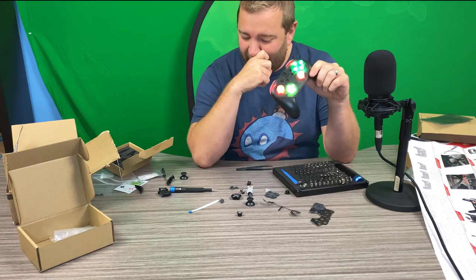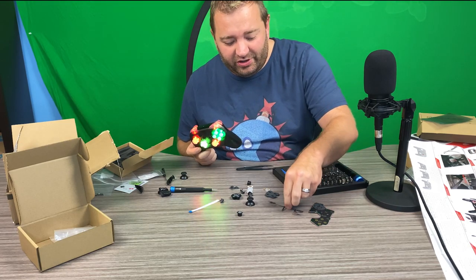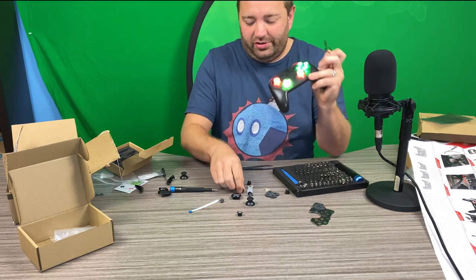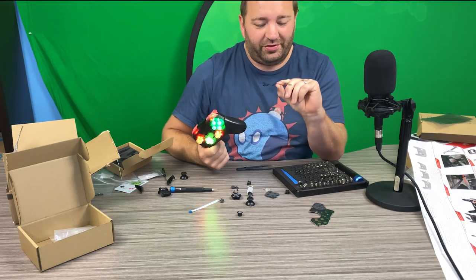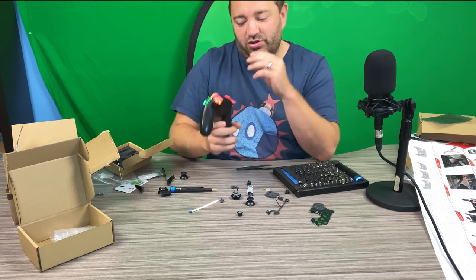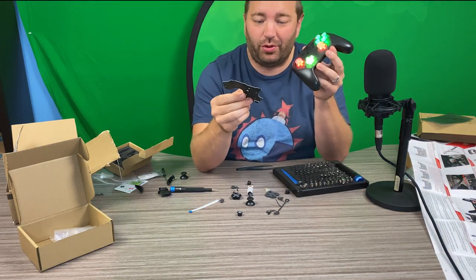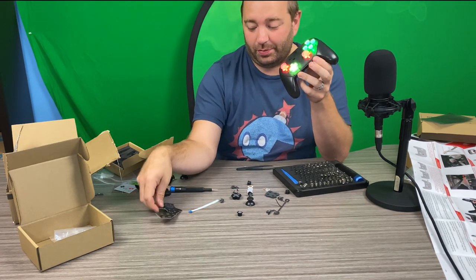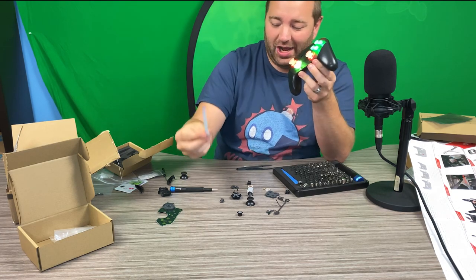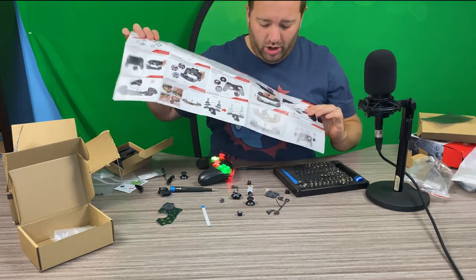Installing this is definitely for more advanced users — people comfortable taking apart electronics. It's not too difficult. Taking off the little ribbon that works for the shoulder buttons is probably the most difficult part, because Nintendo had it glued down when it didn't really need to be, since the buttons that push in would suffice to hold it. When you install this, there is no glue on the replacement cable that has the RGBs for the shoulder buttons. The RGBs under the sticks are attached to the top board, so you end up replacing the top board. Replacing the board isn't that hard — just a couple of ribbon cables.